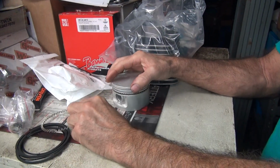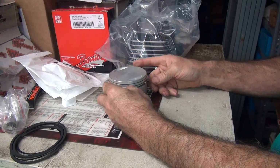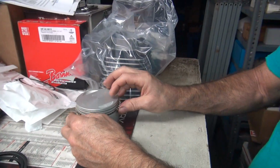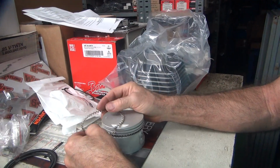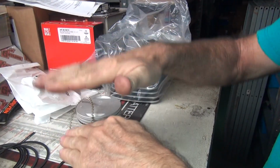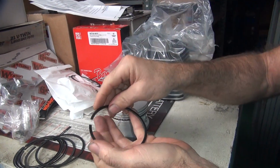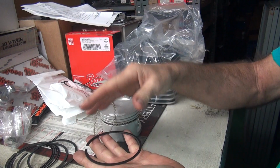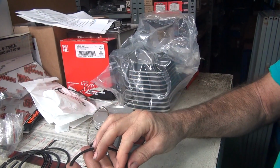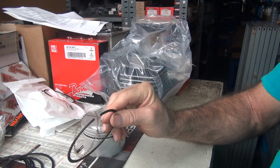What you don't want to do is wrap it, which is where you go like this. Go like that. That's bad. On these piston rings right here, that makes it into a big spring, so it has to compress before it seals. So the time it takes for that spring to compress down flat from cylinder pressure, it's leaking past. So it causes oil control and blow by problems. So your piston rings need to be flat.